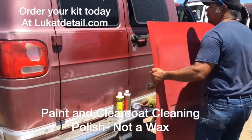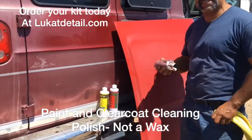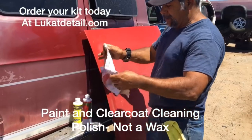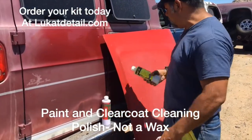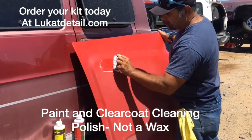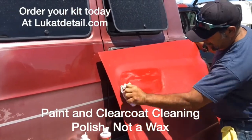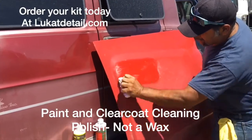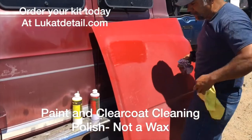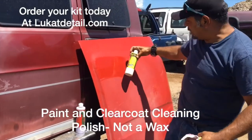Now this is a clear coat. I'm going to show you guys something. A lot of people call me up wondering what's going on sometimes when the paint comes off. This is old dead paint — it's a base coat. Before clear coats, they used to put base coats on cars — thick, thick base coats — and they last a long time. This is a clear coat that's oxidized. You're not going to see any color coming up because we're cleaning. Same thing — no circles, you go back and forth. This is a cleaner, not a wax. All you're doing is cleaning. It's drying up fast because it's hot — like 98, 99 degrees. But look how beautiful this is coming out. I'm not waxing, I'm cleaning. This shine is already there. No wax, because I cleaned it first.